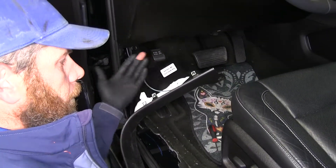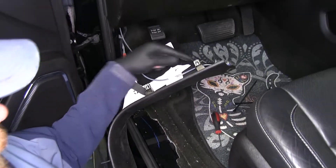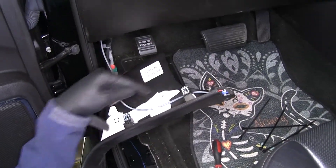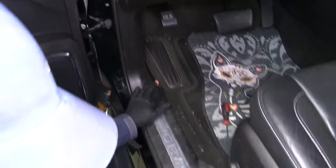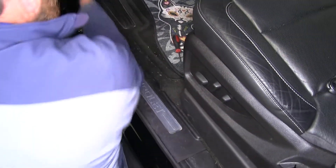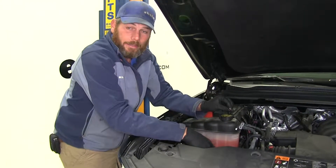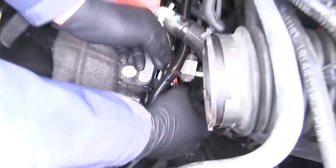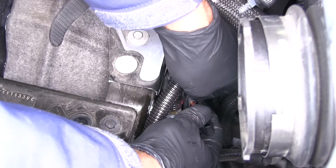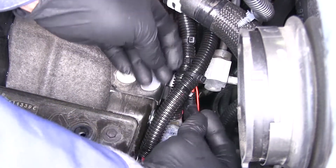Slide the panel back in place — we're done with our switch. Just make sure that wire is not going to get caught in either of the two clips. Now we need to take our 7.5 amp fuse and place that in the fuse holder connected to the disconnect itself. Pull the black cap off, place in our fuse, and then put that cap back on.